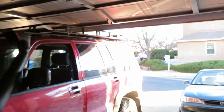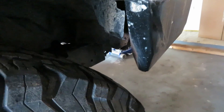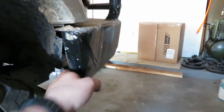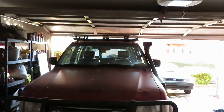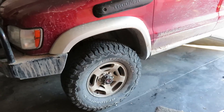Something I noticed: my front bumper is a little tweaked and doesn't mount up exactly perfect. Right here at the front, this tire rubs. The added weight of the rack added just enough that every time I turned, with the load coming down on the right side on a left-hand turn, it was rubbing bad. So I greased up the torsion bars with penetrating fluid and added a little more lift up front to compensate. We'll go around the block and see if I did it evenly, because I feel like I did more on one side than the other.